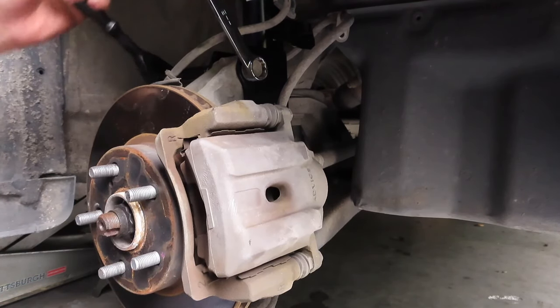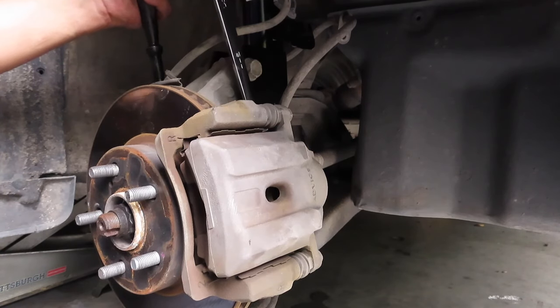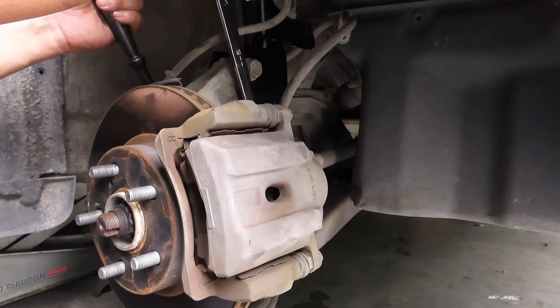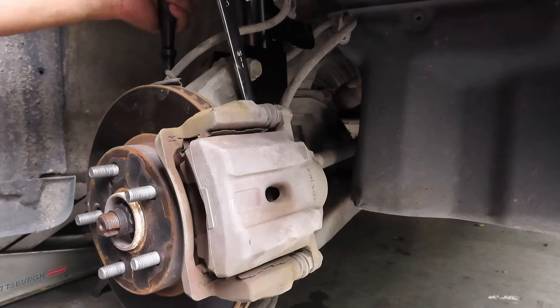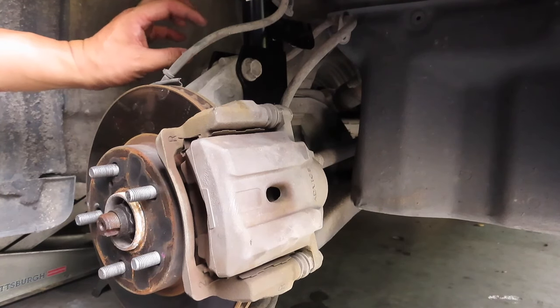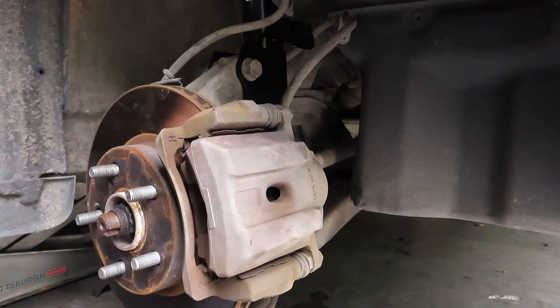Now keep note that when people align this vehicle on the Prius, this is where they're gonna align the wheel, okay? That way the tire doesn't rub against the suspension. So this is one spot that they're used to align the wheel. So keep in mind, there's a special bolt that goes in here that actually turns, that will align the vehicle, the suspension, and the wheel. So once you get this out to an alignment place, they may charge you more because that is needed.